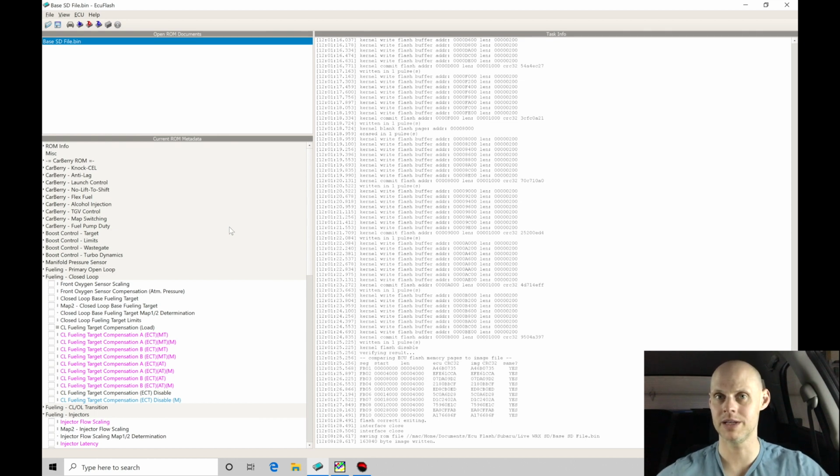So when we're getting it up and running, we don't know if we have any kind of errors in our fuel side of things, the conversion from fuel mass into the pulse width with our injector data. Most likely in this car we do, because we didn't have perfect data to start off with. Or we don't know if we have something off maybe on our air mass side of things. We might have one or the other being incorrect,